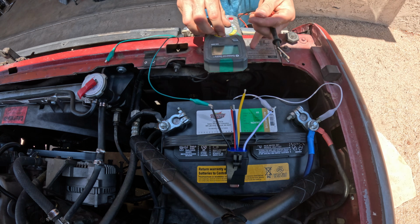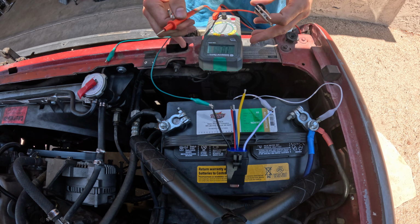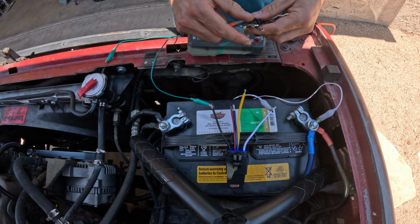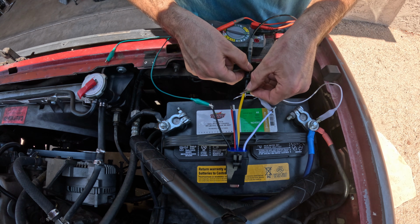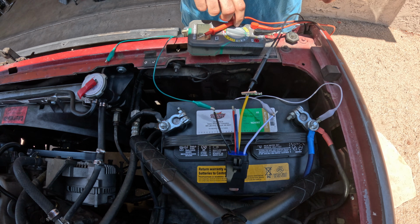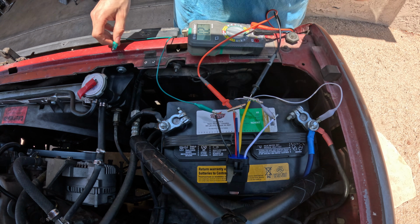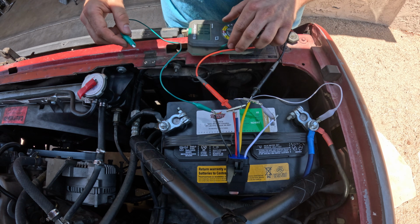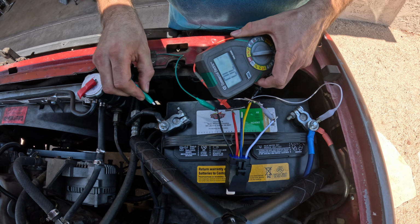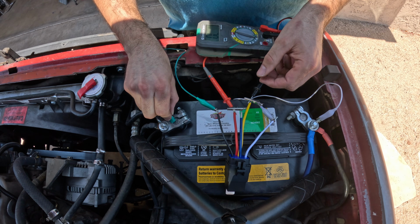And now we can look at our other color wires. I grabbed my multimeter and set it to ohms so I could show you this easily. When my multimeter is in ohms and it touches 2 continuous wires, meaning signal passes through each other, the multimeter makes a loud beep. So anytime you hear a loud beep from the multimeter, it means it's touching 2 continuous wires. I'm connecting it to this yellow and red wire. When the relay is inactive, it's continuous. But now look what happens when I activate the relay. With the relay active, those 2 wires are no longer continuous.